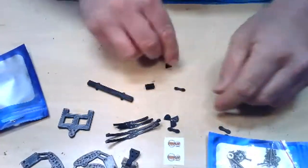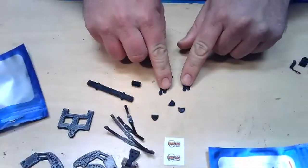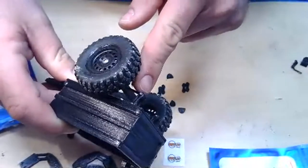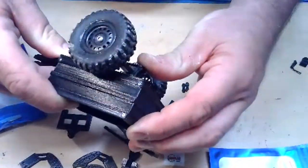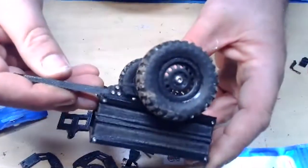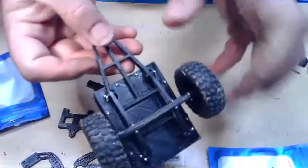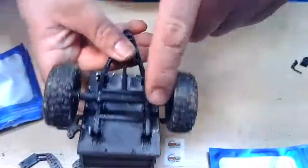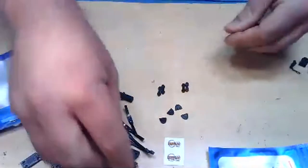These are your little joints for the leaf springs. Four of them go to the rear of the trailer — those are what give you more spring movement. That's where the back of the leaf spring mounts, called shackles. In the front you've got this little joint — there are four of those that bolt right through the frame rail and go all the way into the other end, and your leaves are captured by the two on each end. That's all the basic small parts.